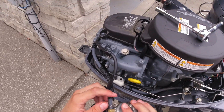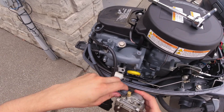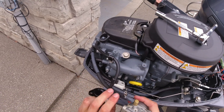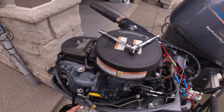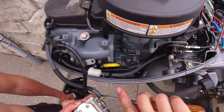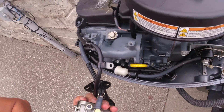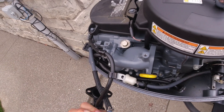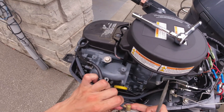One more thing — just the fuel line. These are super simple, probably the easiest part of it all. Just pop off that clip, then take a flathead screwdriver and work at it evenly on all sides, slowly prying it up like a lever. It'll eventually come off and we'll be able to take the carburetor into the garage and open it up.